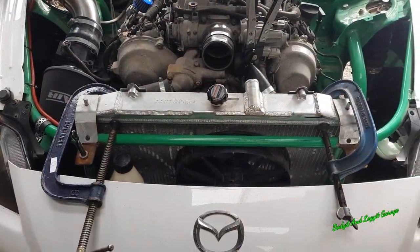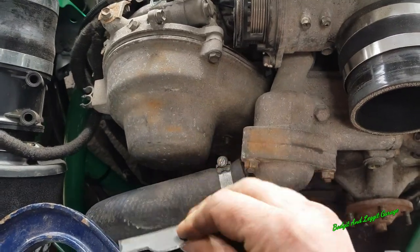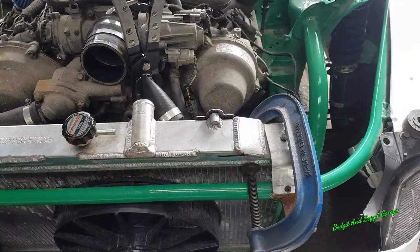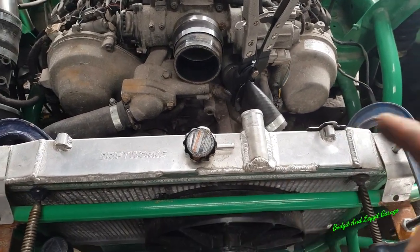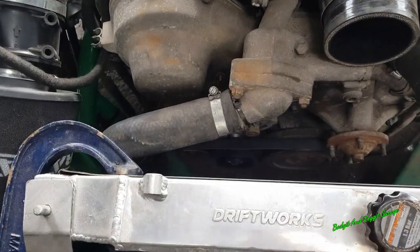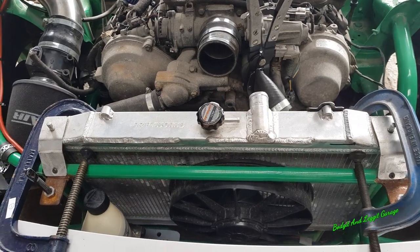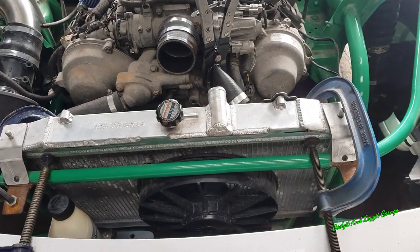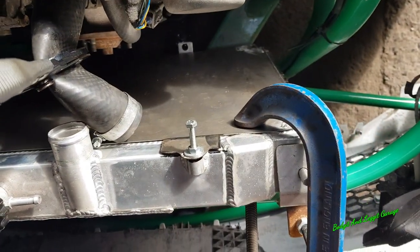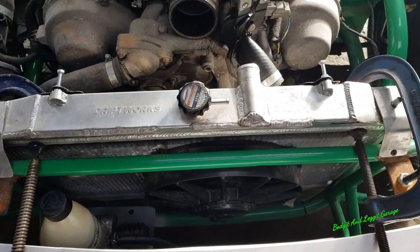I've cut two little tabs - I'm just going to get the rough shape and then go over them and get them a lot better. They're just little rough shapes at the minute which I'm going to weld onto the actual sheet. Once I get the proper line sorted, when I'm restoring the Citroen I'll be showing a lot more metalwork - how to do cold rolling, how to bend and shape stuff in a lot more detail. But I just need to get this done quickly. I'm going to shape these a lot better and get them looking nicer, then weld them on. I've still got a bit more shaping to do but as you can see, they're both held there with the screws and it's looking a lot better.